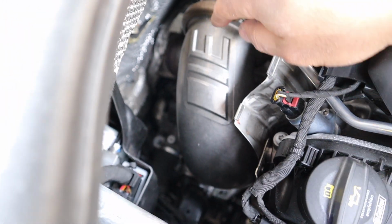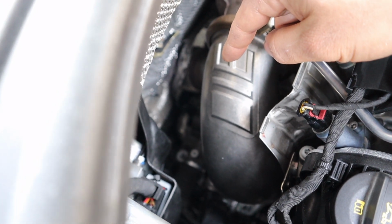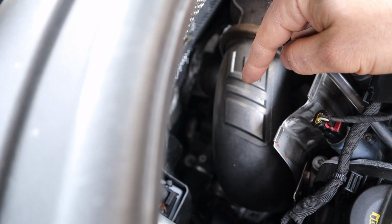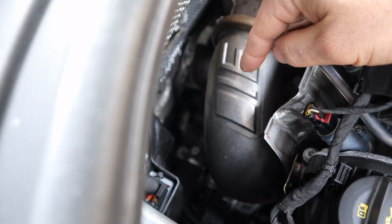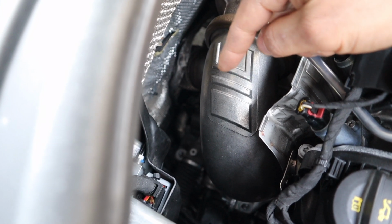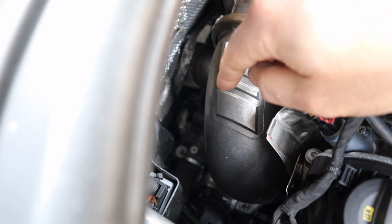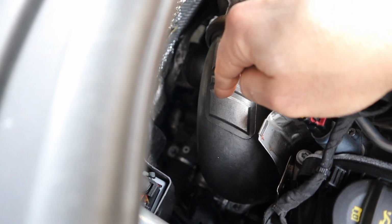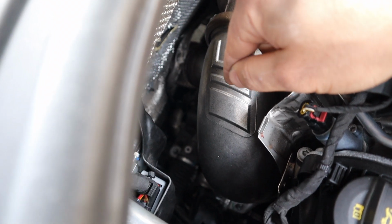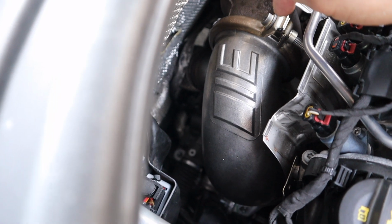Another thing, I know earlier in the video, I'm going to try to edit it out, but if it's still in there, you saw me put the O2 sensor and O2 spacer in before I put the downpipe. Well, I ended up having to remove it to get the downpipe in and up, and then, while it was loose down there, get the O2 sensor and spacer on the pipe and tighten it, which was just as difficult a task.